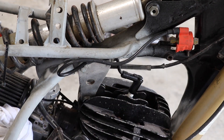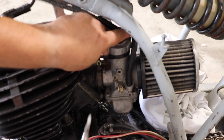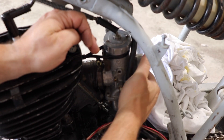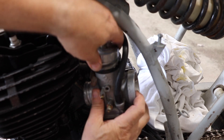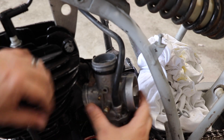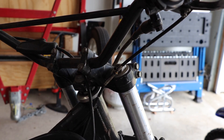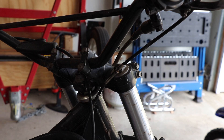We will remove all the wiring that remains. We can actually remove the carburetor — we will unscrew it from the boot. I'll also take off this inlet filter. Pop out the carb that's spewing gasoline. Take off the top cap here — we've already unscrewed it. Take it to the piston; we'll leave this hang there. Here is our carburetor. Taking out that cable completely, we're going to cut more straps. You don't want to ding this up — you want to keep it nice and smooth. It actually looks really good.